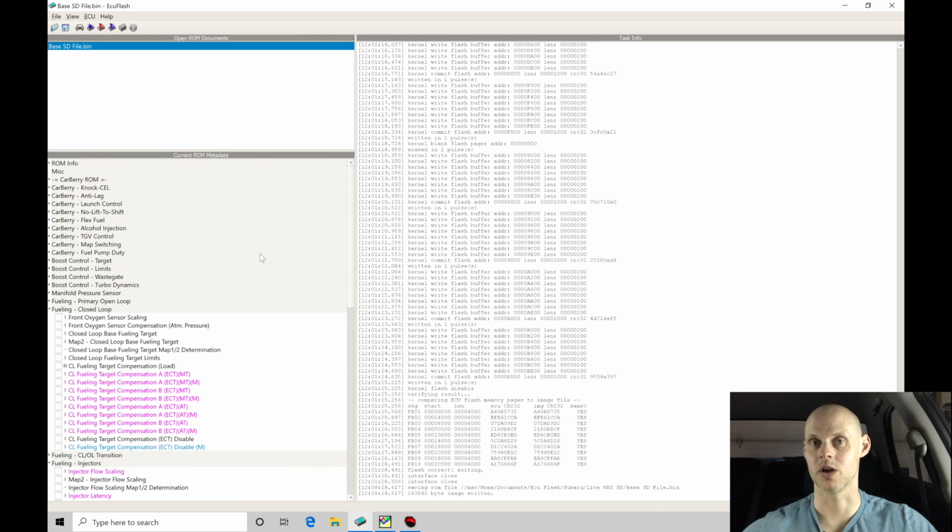So in this particular turbo, the actuator is rated at about 1 bar or 15 psi. That's the minimum that we're probably going to be able to build on this. Now, I don't know until we start doing some pulls and we see what it actually builds mechanically, but that's what I'm expecting it to build. So we set our target boost to roughly 15 pounds and we zeroed out all of our wastegate duty cycle tables so that we were starting off on the lowest boost possible.